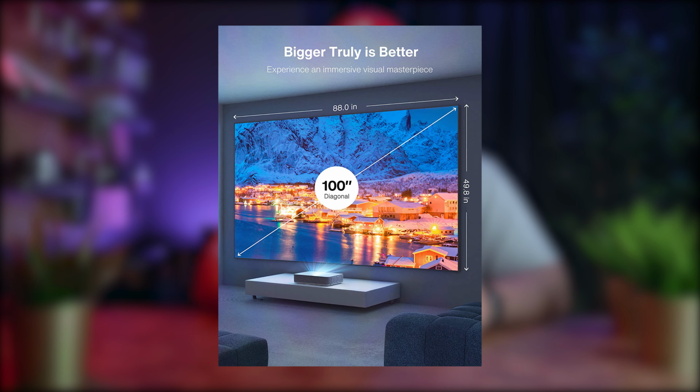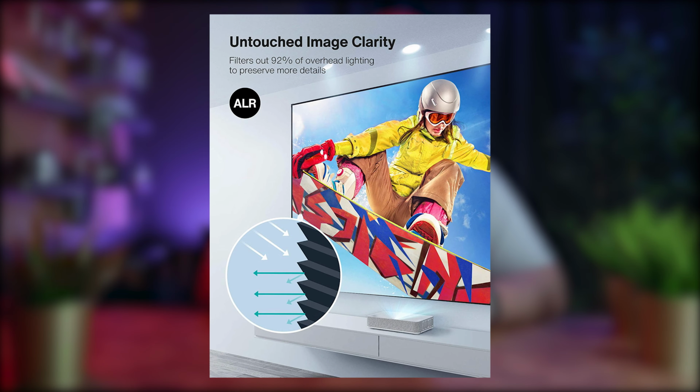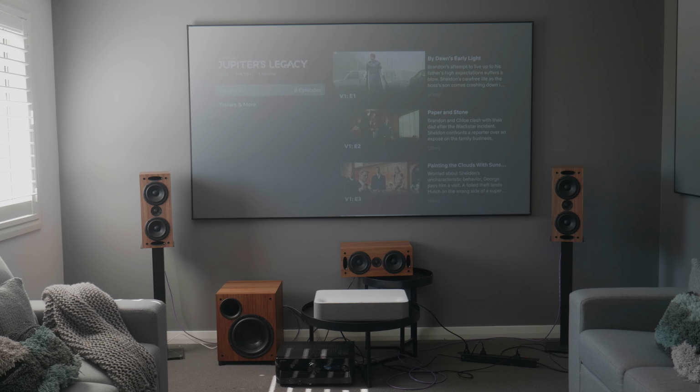So to give a quick overview of the screen itself, it is 100 inches. It is designed to be an ultra short throw screen with material that will reject light coming from all angles except from the bottom. So you can use this screen with some ambient light. It won't work completely in full or direct light or light that's coming in from the side, but it does work pretty well in most situations with the blinds down and only low light in the room. I will have some demos later in the video showing the screen's performance under various lighting conditions.